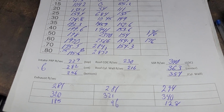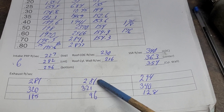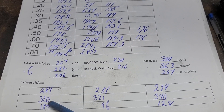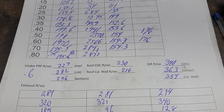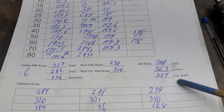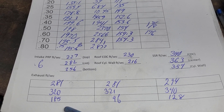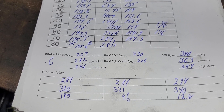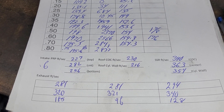Not terrible, and according to the airspeeds at the bottom you can see why — this is quite good for a stock port. 281, 281, 294 — a little high in that corner, but not bad. Right across the top: 320, 321, 340 — a little high over here. The center of the cylinder is on this side, this is the cylinder wall side. It wants to stay right to that cylinder wall, right to the center of the cylinder wall, coming out on the top — not so much on the bottom. The bottom is almost dead all the way across. The top two-thirds of that port are working quite well, so I don't see any problems getting some nice gains out of these.